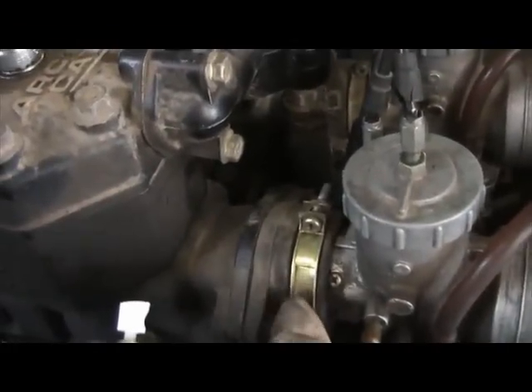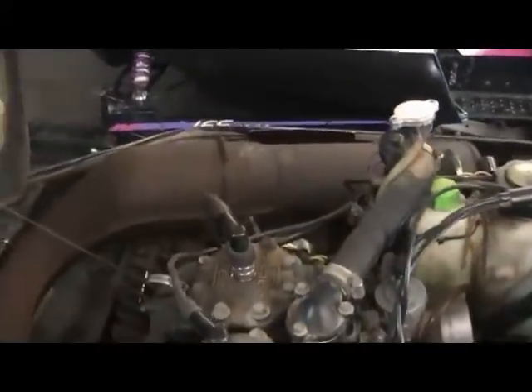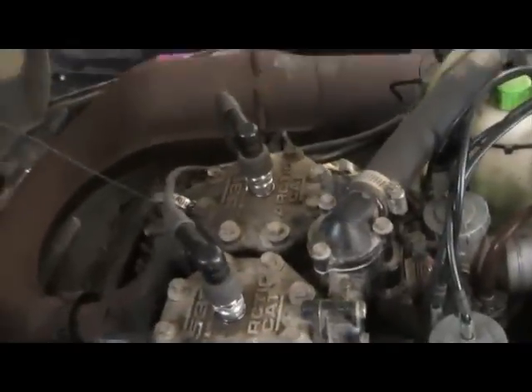Anywhere that you suspect there's going to be a leak — usually it'll happen around the carb boots right there, where the carbs connect to the motor, to the jugs, the cylinders. It'll also happen around the base of the jug right there. And the other common one would be down here at the crank seal, because in a two-stroke motor there is no oil in the crank case — the crank case is oiled by the oil that you mix with your gas or put in your oil tank. You check it the same way that you would check an intake leak, so we'll fire it up.